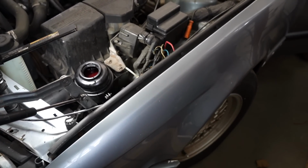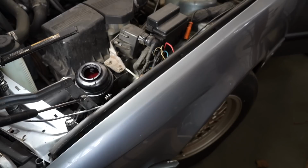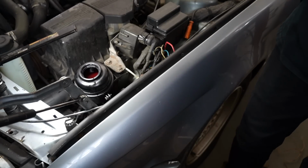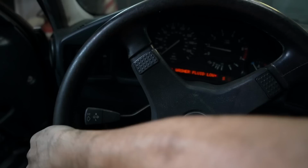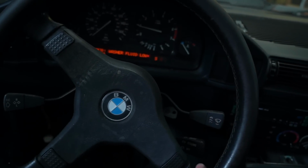It's good! No way! It sounds 20 million times better and it's so much smoother. Let's go! It's good! It sounds so good now. I really think that the missing bolt was what was doing most of that leaking air. I probably could have put a bolt on it and it would have been fine, but I didn't know. But now look at how easy it is. The tires have low air, so it's still kind of hard, but it's no more noise. I can definitely tell that it has power steering.